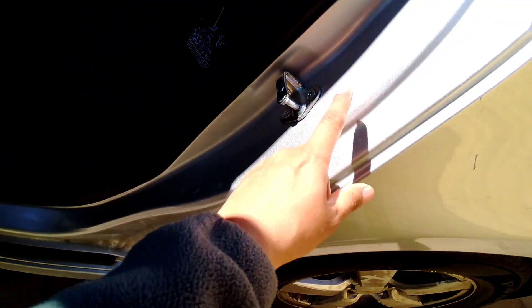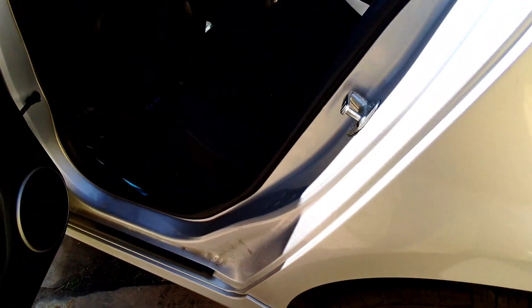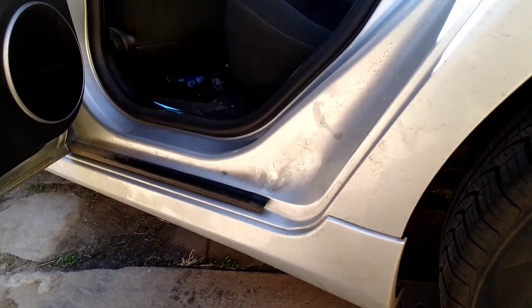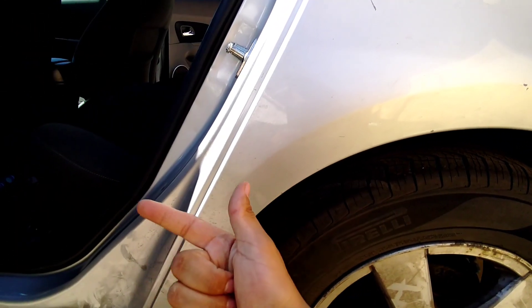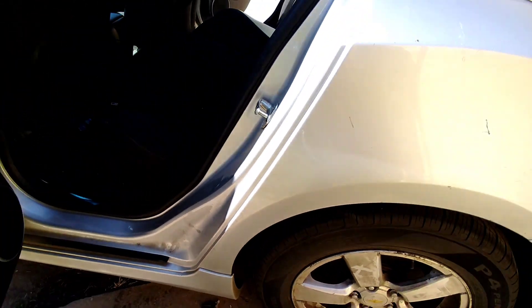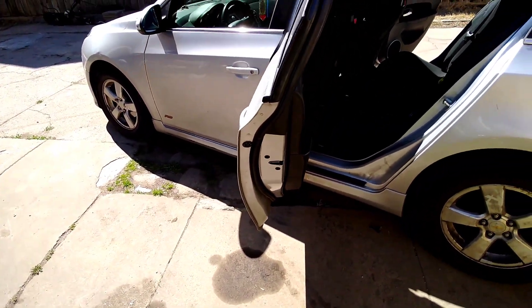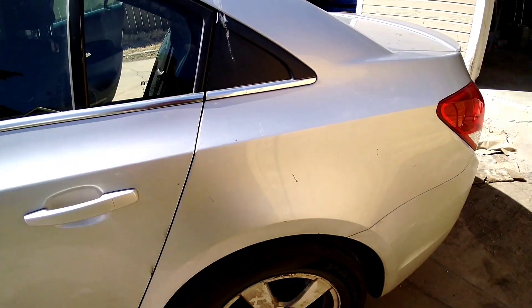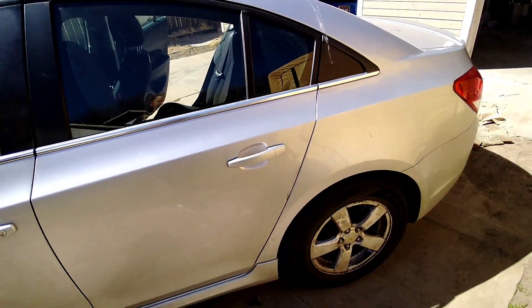It looks like the damage was just down there, with more damage up here. We have a little indentation right there — apparently that's OEM, I guess it's for the door hinge that goes in there. Down here doesn't look that bad either. Our hip is going to be right here and we'll pull it that way. It's not too bad, we can work with that. The door was smashed in — I'm going to have to take my measurement tape out and get it aligned so we can line it up just like the other side. Alright, let's get started.